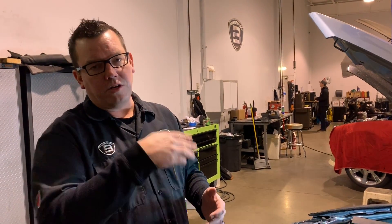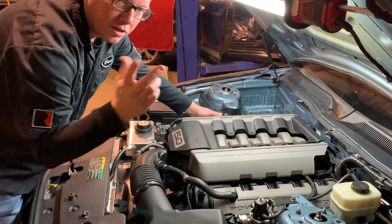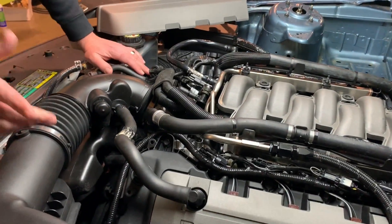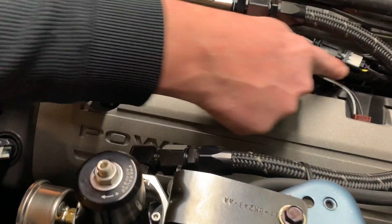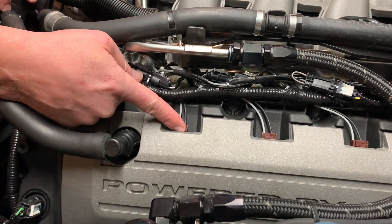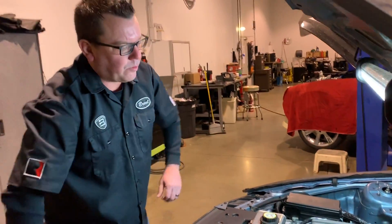It's going to hopefully hook. After launch it uses the normal rev limiter — whether that's 7,500 or higher or lower depending on your calibration setup. Besides that box, here's all you have to do: mount the box, run the two wires — a ground and your activation wire. Your coil packs are down underneath this cover. This whole harness right here is your MSD harness — it's plug and play, no splicing, no cutting. You unplug your coil pack, one end of the wire into the harness, the other into the coil. That's it. Zip tie everything, put your cover back on, and you can't even tell it's there.